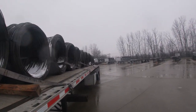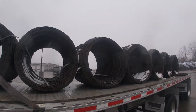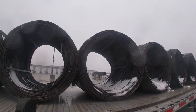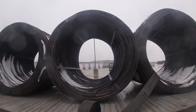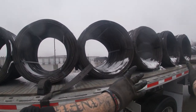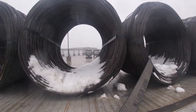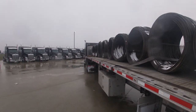This load has 11 coils and I want more than half pulling backwards, so the first six pull back. That means coil seven starts pulling towards the front. Throw it through, pull towards the front — easy concept. I'm not centered; I'm pulling towards the back of that section since this is now technically the front of the load. Skip because I'm alternating. Now I've got one side thrown and I'm going to come around the corner to set up for butterflies on the other side.